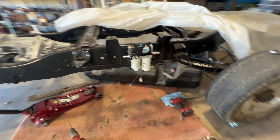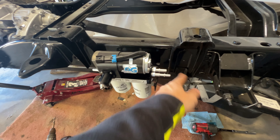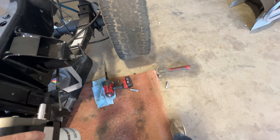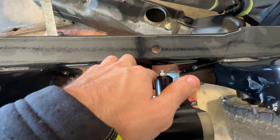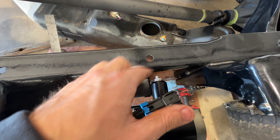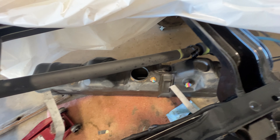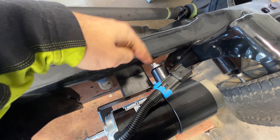So I've got the pump in my hand — we'll gently drop it down right here. That's where she's going to sit on the truck. We do have things a little reversed as far as which direction this needs to run. If I put it on here backwards, the fuel supply line looks good but the PSI adjustability is back against the frame. They said to mount on the inside of the frame, but I don't have room on a single cab truck — the frame runs from your transfer case all the way to your axle. So this is the way we're going to have to run it — it's preset to 15 PSI, and anything over 18 you start to jeopardize the integrity of the VP44 itself.